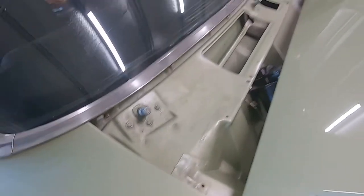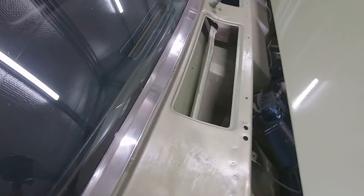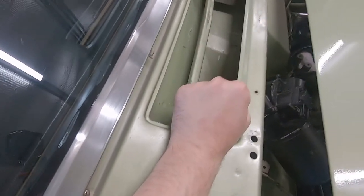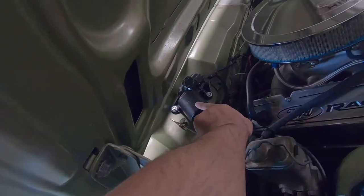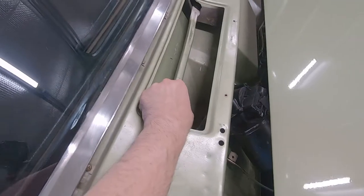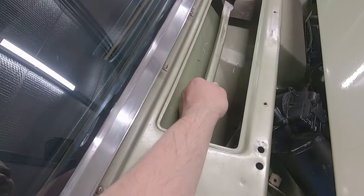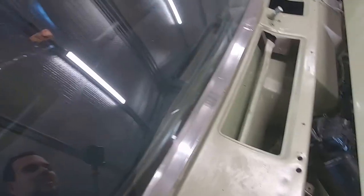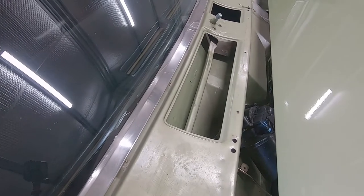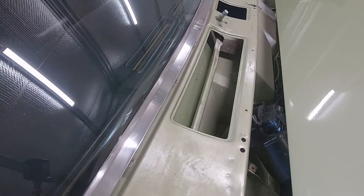All right, that's a two second job to get that scuttle panel off. You can see here that this car's been painted, probably about 10 years ago, and when they did it they haven't bothered removing or taping up anything, because this is all kind of overspray onto the mechanism down here. So there's your wiper motor there. That drives that mechanism down there to rotate, and in turn rotates this rod, and that's how your wipers go back and forth. If you have a look there's a fair bit of play and a fair bit of clunk in there. There's five pivot points I counted on this whole mechanism, so after 40-odd years I'm hoping those worn pivot points are the cause of this whole issue.